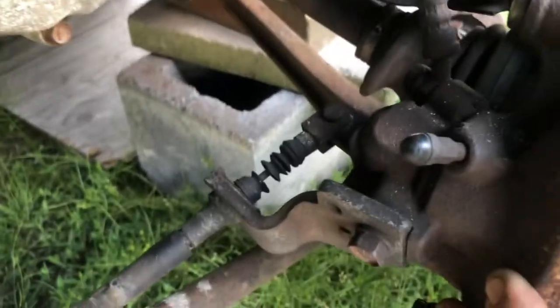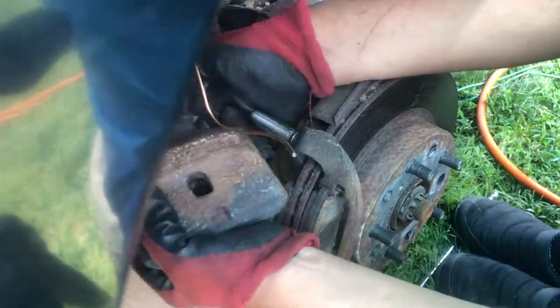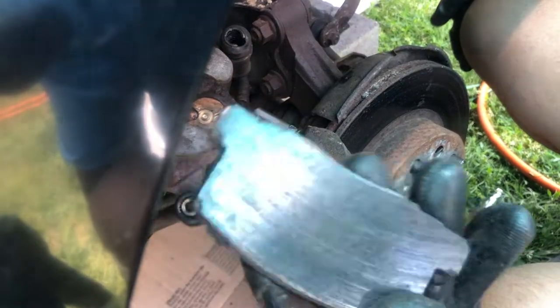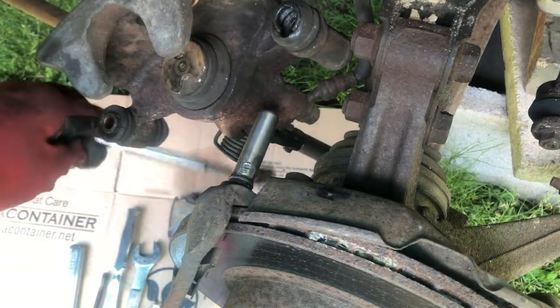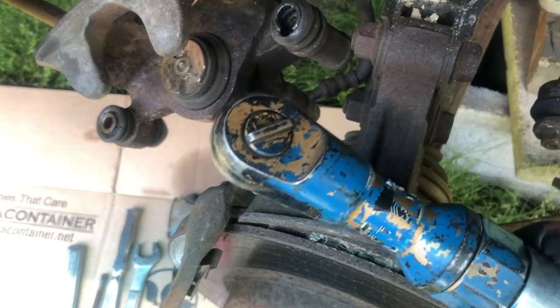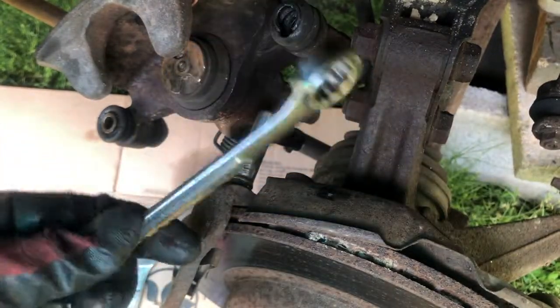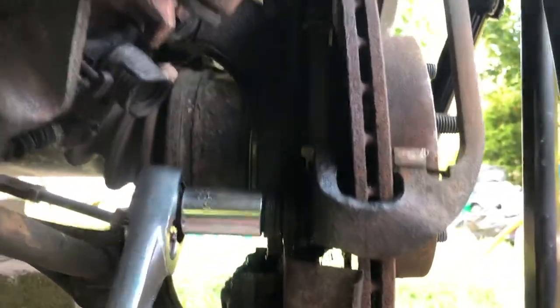I knew in the near future I'd have to do this anyway, especially if I'm going to change the calipers one day. Here's one of the brake pads — here's the other side. As you can see, it's bad. The brake caliper bracket is a 17mm up top and another one down there. I'll try the air gun first, and if not, we'll use brute force. I was able to break free the nut with my breaker bar — that one is freed up as well. I'm just loosening and spraying more PB Blaster, hoping for the best.